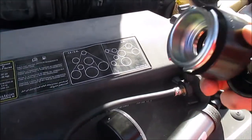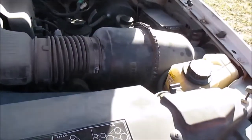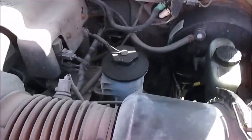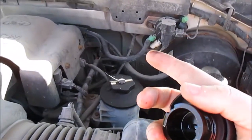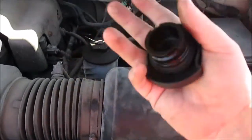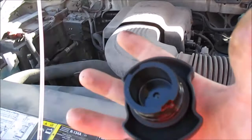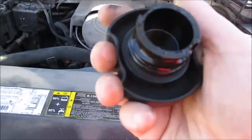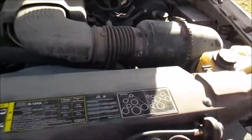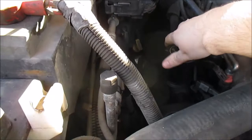Anyway, I was trying to explain why I suspected I had coolant issues, but it turns out I think it was just the crazy cold weather condensing on the underside of my cap. When I pulled the dipstick and looked at the fluid, it wasn't milky or anything — if coolant was leaking in, that oil would probably be all contaminated and nasty. All I had was just a little bit of sludge on my cap, so I changed the oil, I've been watching it, and I haven't seen any white stuff come back. Just to be sure, I'm going to do some pressure tests.